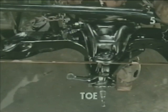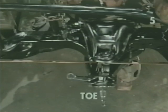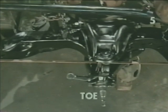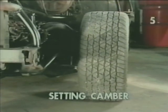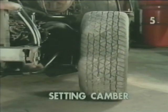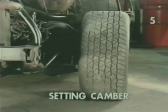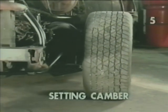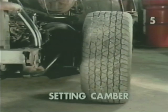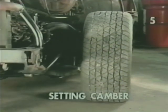After assembly is complete, we'll then show you how to square the steering linkage, set toe, and set adequate camber alignments so that you can safely drive your vehicle to a shop for a final alignment. With the vehicle back on the floor, we want to roll the vehicle back and forth several times while pushing up and down on the bumper to settle the suspension.